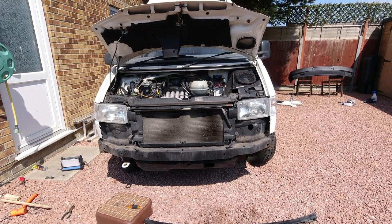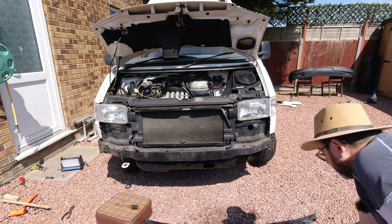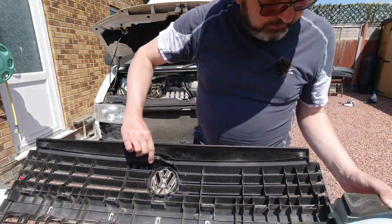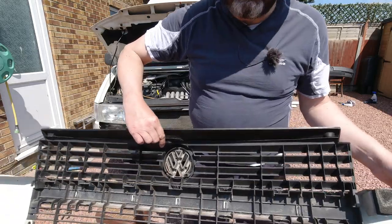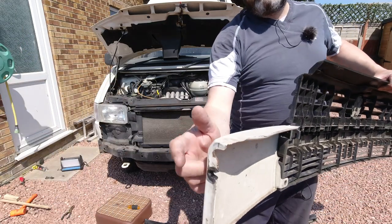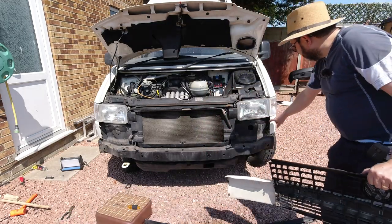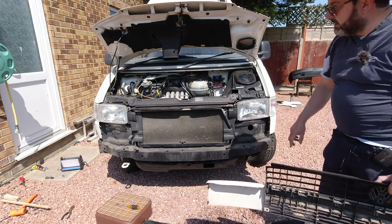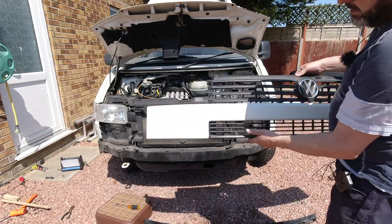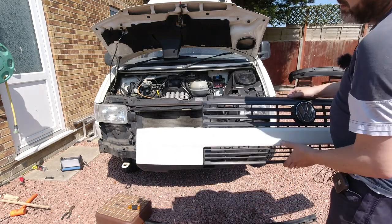While I've got the opportunity I've taken the radiator grille off the van because I can give things a good clean up. The two grilles - upper and lower - are actually one piece and can be unhooked from the metal handle. At the ends of the metal panel are two little horseshoes that hook onto basically rivet heads either end, and there are three screws across the top and a couple of screws in the lower grille - that's it, the whole thing just comes out.